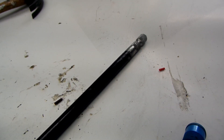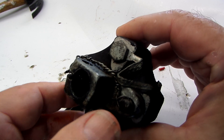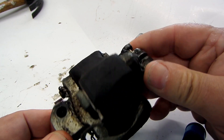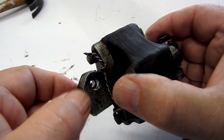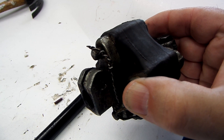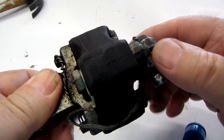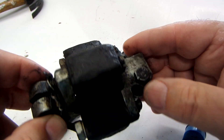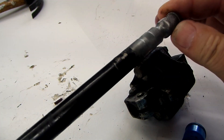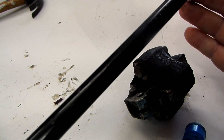The splines on these things don't look that good either. I'm not putting these back on the car. I decided I'm going to upgrade to TR6-style metal universal joints. They have a quarter-twenty bolt pinching the spline on the shaft, and the universal joint for the TR6 has a 5/16th diameter bolt. I'm going to go with that, plus I get rid of this rubber donut thing. I'm going to go ahead and start putting those in, and I have to source a couple of them. I do have a good shaft, so I'm going to pull that out, get it cleaned up and painted and ready to go in the car while I'm waiting for the TR6-style universal joints.